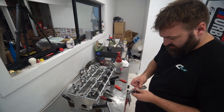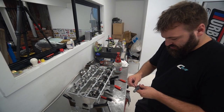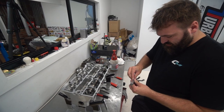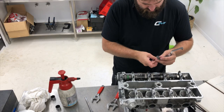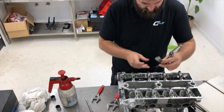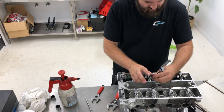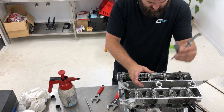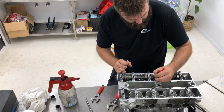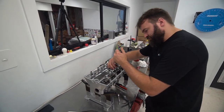That sounds very similar. So just from hearing it, I reckon that's probably going to be about 14. That's probably going to be about 13. So I'll just step right up to start at 10. So 10, 11, 12, they're starting to give resistance. 13, that's a bit tight, so it's about 12 and a half. That doesn't go in at all, so that's 12 and a half and 12. Not bad, so our tolerance is within 1 thou at the moment. Let's keep moving.